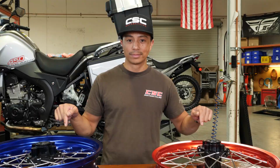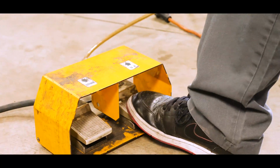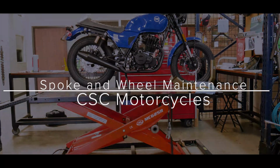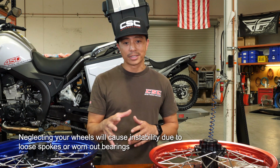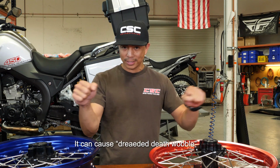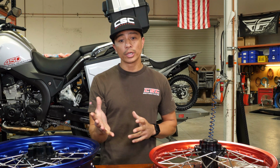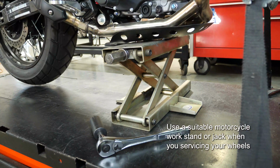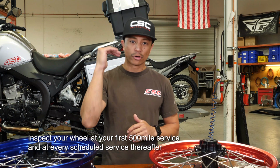And in today's video, we're gonna go over one of the most overlooked procedures in motorcycle maintenance, maintaining your wheels. Now, neglecting your wheels will cause instability due to loose spokes and worn bearings, and you'll get that dreaded death wobble. Now, when servicing your wheels, use a suitable motorcycle stand or jack, and inspect your wheels at your first 500-mile service and every scheduled service thereafter.